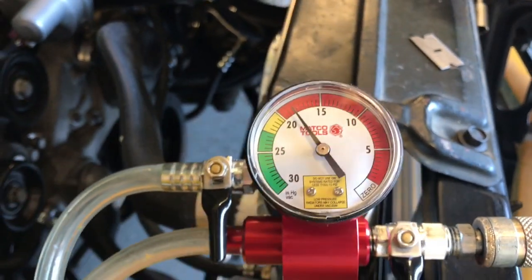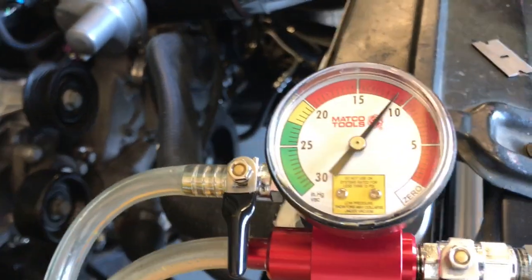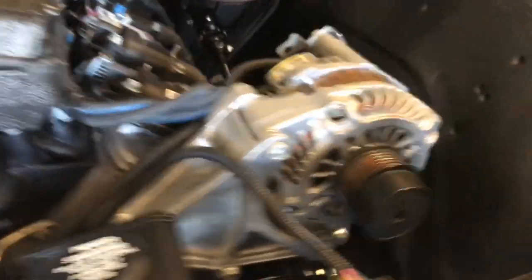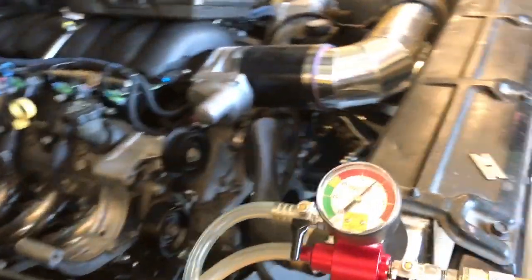So now we just find that. We did the leak-down and it actually was leaking — we lost vacuum. I just looked around for the obvious stuff and found it: the petcock down there was not all the way tight. So let's put some pressure in it again and see.